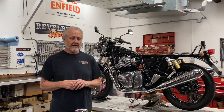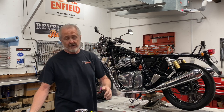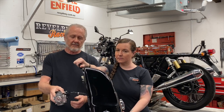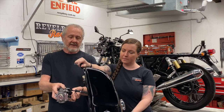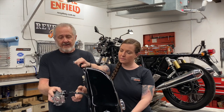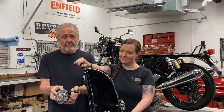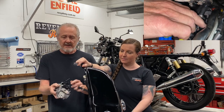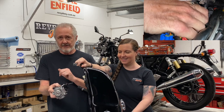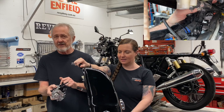There is one caution I want to give you. In either case, both tuners, you'll have to remove the seat, fuel tank, and both side covers. One thing about removing the fuel tank that you need to be really careful about is the quick connector for the fuel rail. That quick connect is in there on an angle and it is really tough to get to the front trigger. There's a trigger front and back that you have to squeeze together to remove that quick connect from the fuel rail. This is an operation that requires finesse, not force. If you don't have these completely triggered and you pry on it to try to get it loose, it's really easy to break this plastic fuel rail. That's not something you're going to fix with duct tape — you're not going anywhere until you have a new one. So get both triggers completely released and gently lift this quick connector off that fuel rail. If you go on the wrong angle and pry it, it's going to ruin your day.